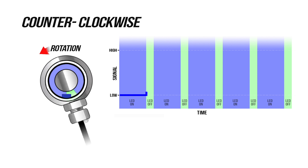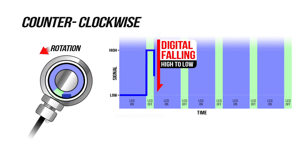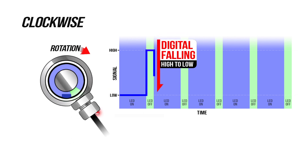On this edge of the magnet, our camsync is set as digital rising. The other side or edge of the magnet is digital falling. Use the same procedure for a standard rotation engine, except the opposite is true — since it rotates clockwise, digital rising occurs on the other side of the magnet and then digital falling.